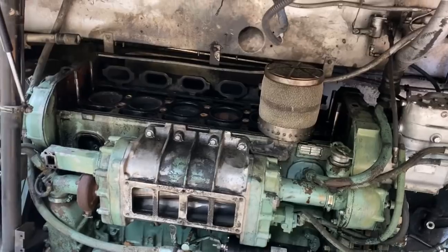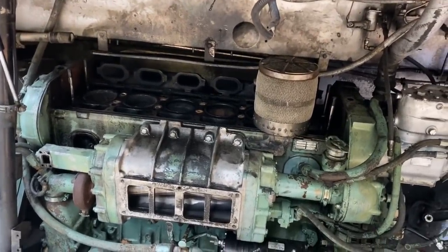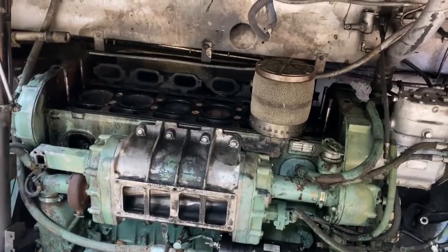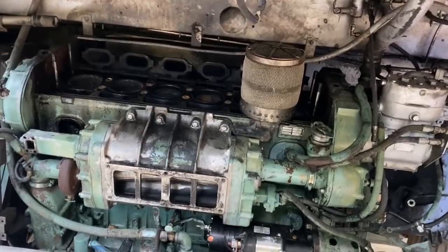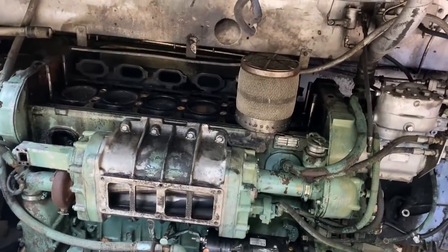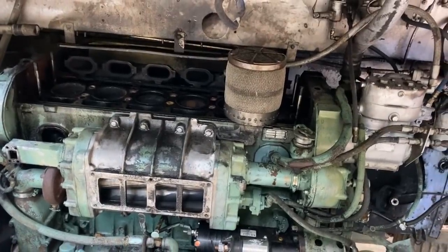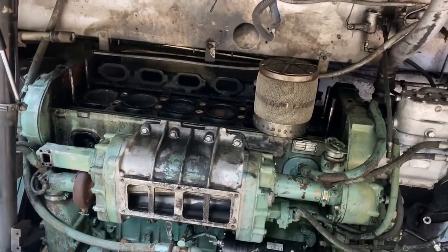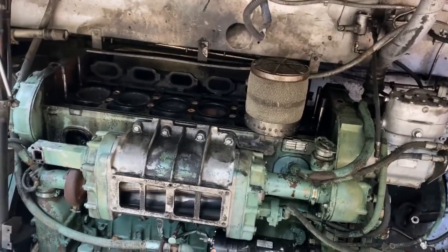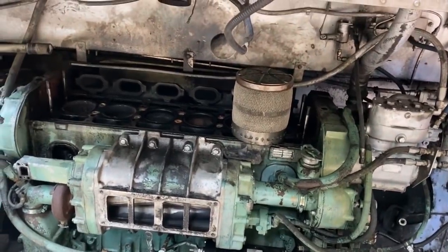The oil on this thing, when I looked inside the head, it was just the thickest, nastiest, gooeyest, sludgiest stuff I'd ever seen. Normally the inside of the head is completely clean on these. It's black oil because it's a diesel, but usually everything is clean and there's no buildup in the corners and stuff like that. So the dust had just ruined the engine and gone through the oil, and these things don't filter oil as well as a modern filter does either. So from then I knew that was a big concern.